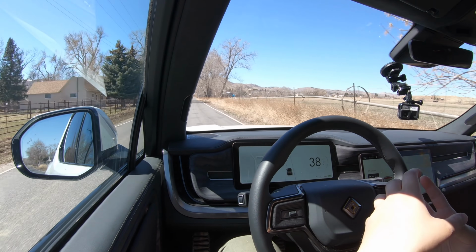But obviously you don't want this soft, wallowy ride on a back road, and so you can basically bump up the hydraulic pressures, and that will basically increase roll stiffness. And it's magical. It's actually, I think, the same parts that McLaren uses for on-road and track performance. McLaren's ride magically smooth on the road and then are so hardcore on the track, and this is kind of like magically capable off-road and then so hardcore on the road, and really soft on the road, and allows for a lot of articulation off-road. So I really love that.